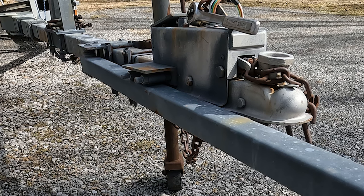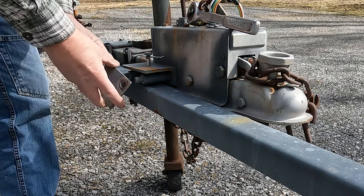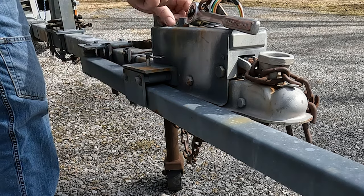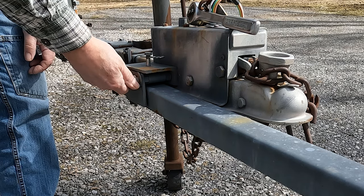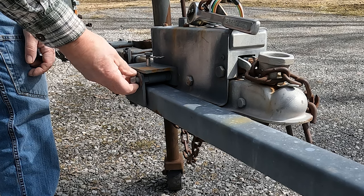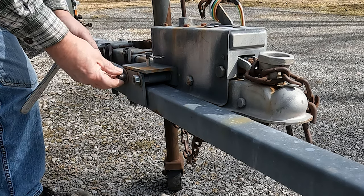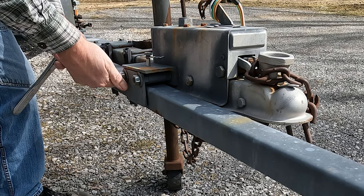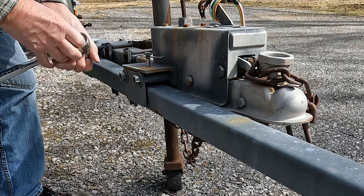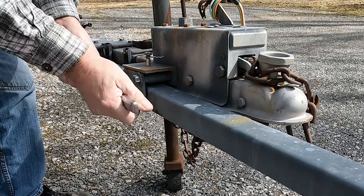Now, my son is a professional welder, but everything is working so great after 4 or 5 launchings and recovery that welding has not been necessary. You can see in the video that the front of the extension swings on a bolt like a hinge forward, and a side bracket is attached to the trailer hitch to support any side movement at the front. The boat weight on the original hitch and the new extension keeps it all in place vertically.